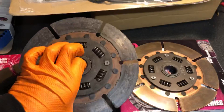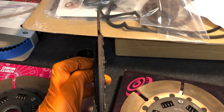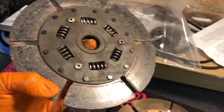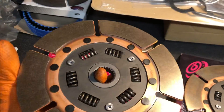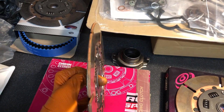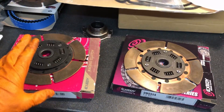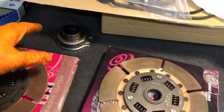The incorrect and unbalanced fitting caused premature wear of the clutch plate. You can see on the left-hand side it's absolutely chewed up, but on the right-hand side it's pretty much got stock thickness — if it had been fitted correctly the plate would still be fine. You can see it started to break apart and it's seen some serious heat. So we've gone and got some brand new clutch plates. They're not cheap, but it's well worth it when you've got the clutch apart. From stock it's only about 2mm of meat, but because they share the clamping load across two plates, they don't wear nearly as quickly. It's a racing clutch — it'll take the heat and the torque we need.